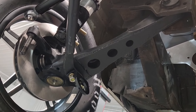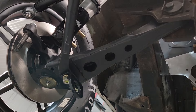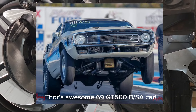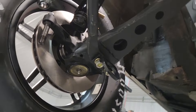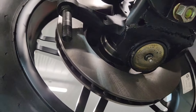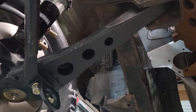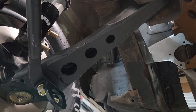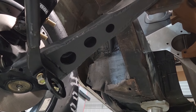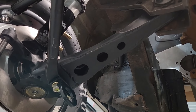These are the lower control arms I was talking about. They're kind of like a hybrid setup. I did a video previously about these, but I've since modified them. A friend, Thor Prestigard, recommended that I box the whole control arm in. I had it boxed from that point to around the ball joint — you can see all the reinforcement I put in there — but I didn't have anything in the back section. He made a really good point that I didn't even think about. Originally these cars had upper and lower control arms to help distribute the weight. Now the car is going to be held up by this lower control arm alone, so it made absolute sense to box the whole thing in.